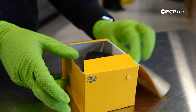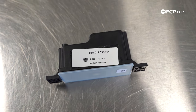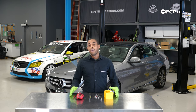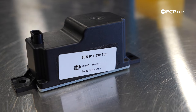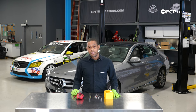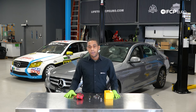The device I'm calling an auxiliary battery may also be referred to as a parking pawl capacitor or a voltage regulator, because it's not actually a traditional auxiliary battery. Its main function is to activate the parking pawl for the transmission in the event that the vehicle loses power. If you notice an error message on your dash telling you to shift the vehicle into park but leave the engine running, or if you have an auxiliary battery malfunction, this could be the device you need to replace. We also recommend changing your auxiliary battery anytime you change the main battery. One thing to note: C-Class hybrid models do not have this style of voltage regulator or parking pawl capacitor — they have a standard traditional size 14 auxiliary battery.